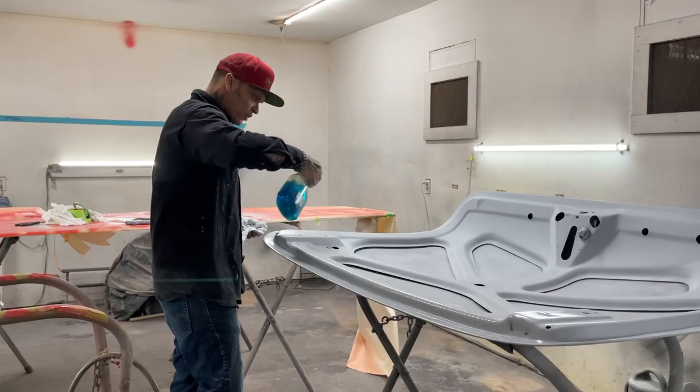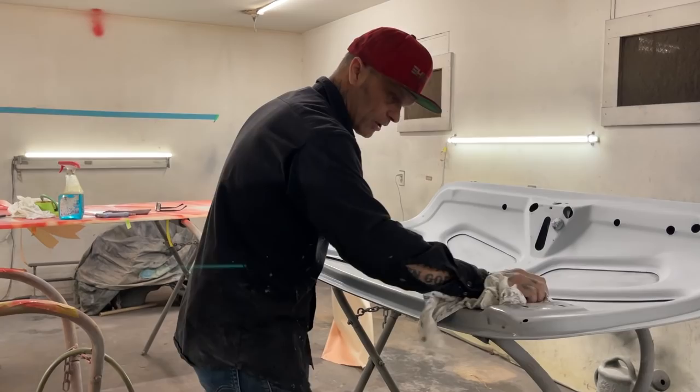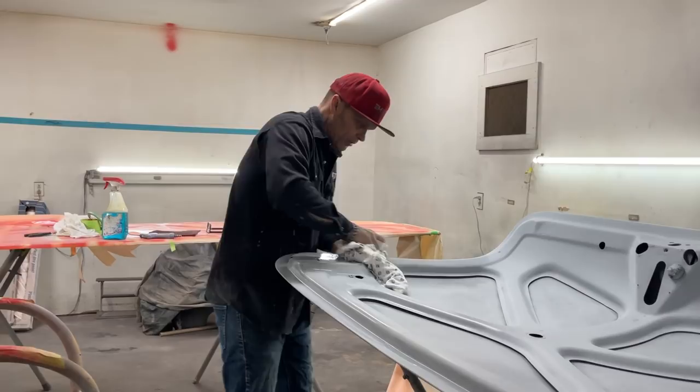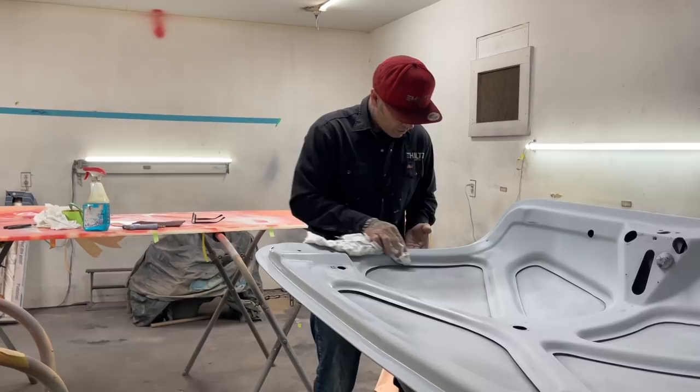And once you paint something, I find the second time around, you can get a better job. Let's face it, if you've got something you don't like, you've got a bit of dirt in it, you do not like it. The second time around generally turns out a little bit nicer because the pores of the paint don't hold as much dirt as the primer does. I think we all should realize that really nice cars are not just painted once. Sometimes it takes a couple times to get a really nice job on something.